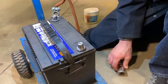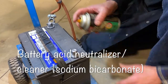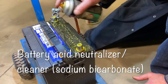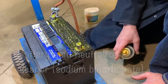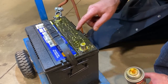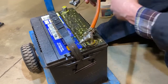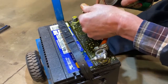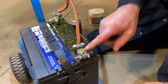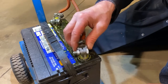When you get a battery that has got acid around it, you can get a product called battery acid neutralizer, which is essentially a strong base — usually a sodium bicarbonate in a suspension of water with a dye in it to show up if you've got acid. If there was acid, it would start frothing up. You can also spray the clamps. A warning: if you ever clean a battery without taking the clamps off, this stuff likes to dry in there and form a powder. I've seen cars stall on the road after cleaning because they didn't take the clamps off — that powder as it dries acts as an insulator.